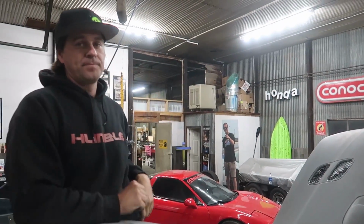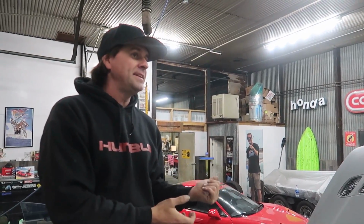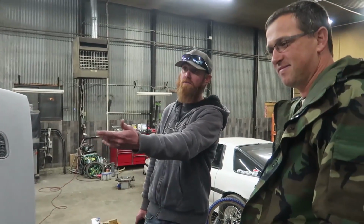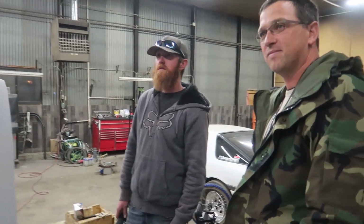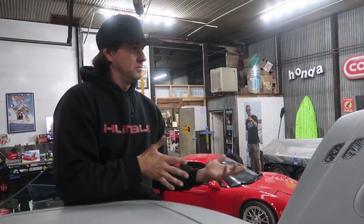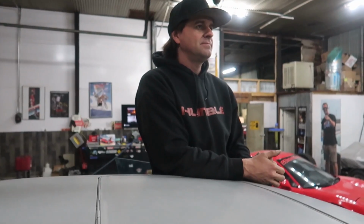He's like, how did it get there that quick, though? I tell you, honestly, I could get full boost at 4,500 RPM. If I ramped it in, I don't know how much sooner it could go. This thing spooled really fast. It's perfect. I know a stock spool is like probably 2,700 or 3,000 RPM, but this turbo is tiny. It's capable of 900 horsepower and it spools, what, 800 to 1,000 RPM slower than a stocker. Yes, please sign me up. I'll buy two. I'm twin turboing everything now.